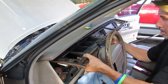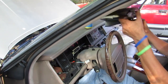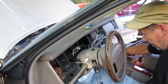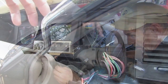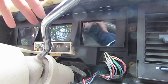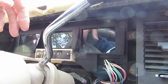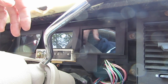The big question is: are you going to inherit the odometer reading from the old junkyard car, or will the new cluster somehow know how many miles are on your car? Some people say the odometer reading will stay the same as your car, but I've gotten a whole slew of answers saying yes, you're going to inherit the mileage from the junkyard car. That's horrible because if you kept the mileage low to maintain the car's value, you could end up inheriting 400,000 miles, and no buyer is going to believe that's not the real mileage.